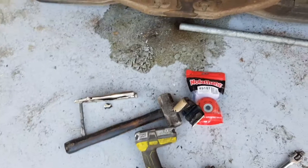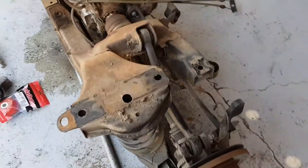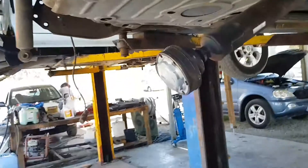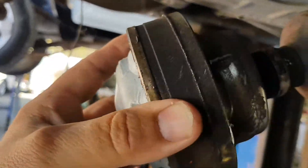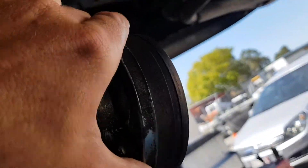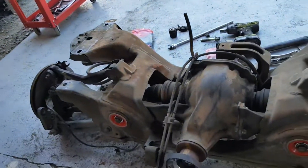When you order, make sure you've got the right parts for that model. The whole rear end has to come out - there are a couple of bolts that connect here, here, and here. You have to take the brake calipers off and you have to drop that centre shaft. When you take the tail shaft off, you've got to be really careful that you don't damage the CV joint. We've had it happen before - it's not taking it off, it's putting it back on. If you damage that putting it back on, you're going to find vibrations and shudders right through it.